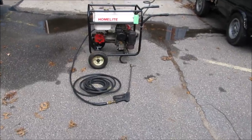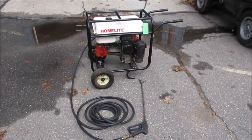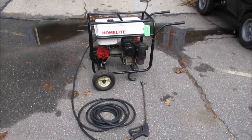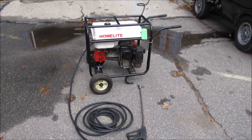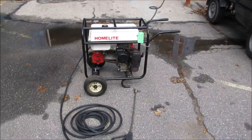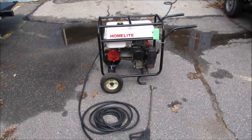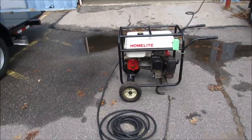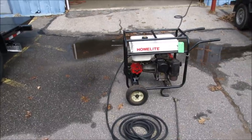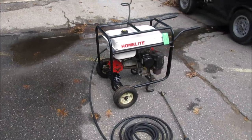Well, guys, I think we're getting to the end of the program about here. The only thing I see is the needle and seat needs to be addressed. It should probably get a new one. No fault of anything that could have been done to save it, as far as, you know, we had gas in it, you had stabilizer, you had oil in it, dry. I think that tip still would have done the same thing. It's just over time the rubber gets too hard and brittle, and it doesn't make a soft seal against the seat, and that's your outcome.